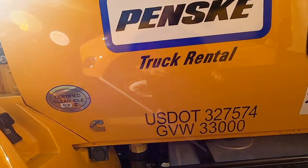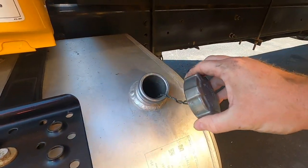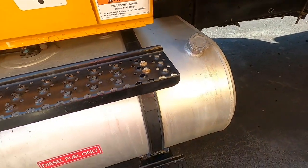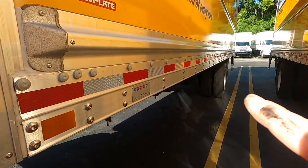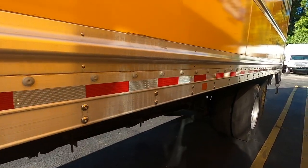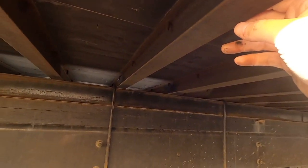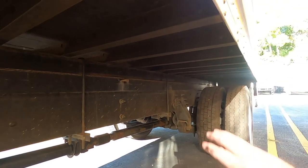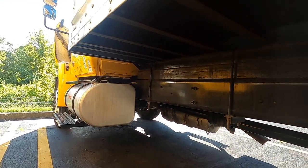Make sure your fuel tank is not leaking — look under the truck to confirm. Make sure the fuel cap pulls off and has the safety chain attached and everything works correctly. On the side of a box truck, the body should have DOT reflective tape covering at least 50% of it. Look under the truck at the cross members and frame — make sure nothing is bent, no missing bolts. On the front tires you need 4/32nds of tread.